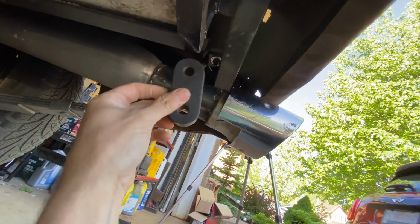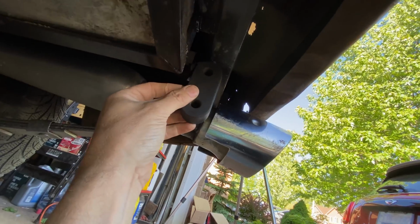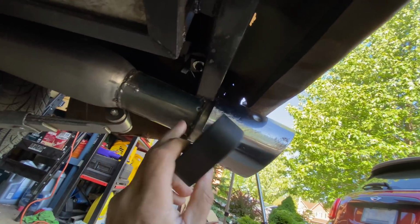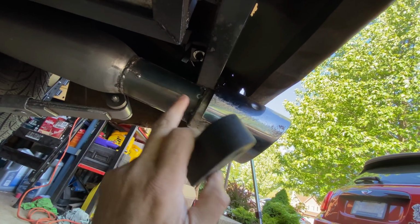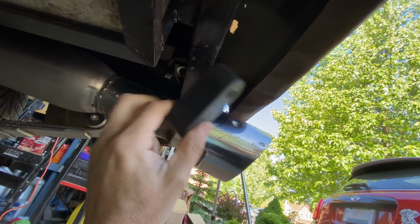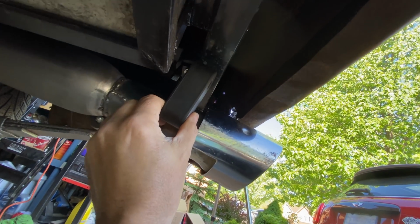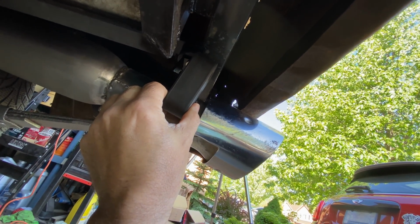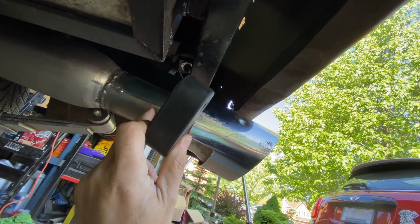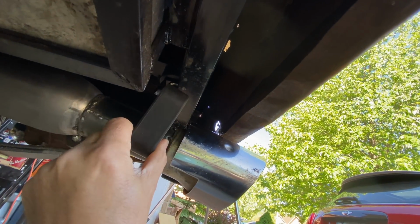So I'm going to use one of these. It will sit, not sure yet, either that way or that way. So there'll be a little loop of steel tubing coming out here to take that, the same on the top. So I need to clean the paint off of that and maybe just tack them in place for now so I've got the right height, and then take the exhaust off, weld it properly to the exhaust, weld it properly to up there, and we are done. Almost there.